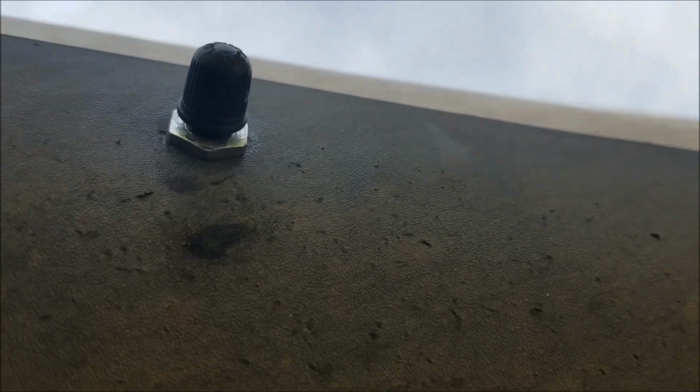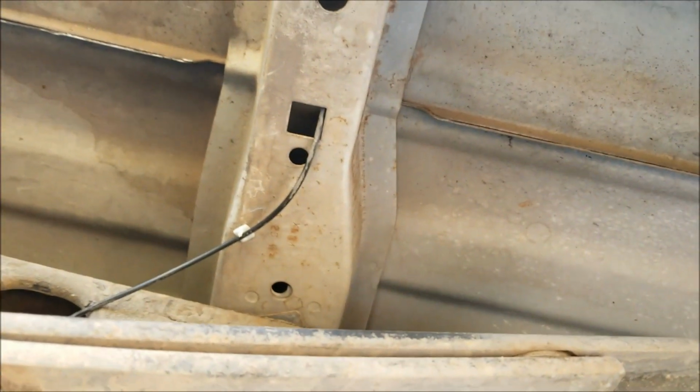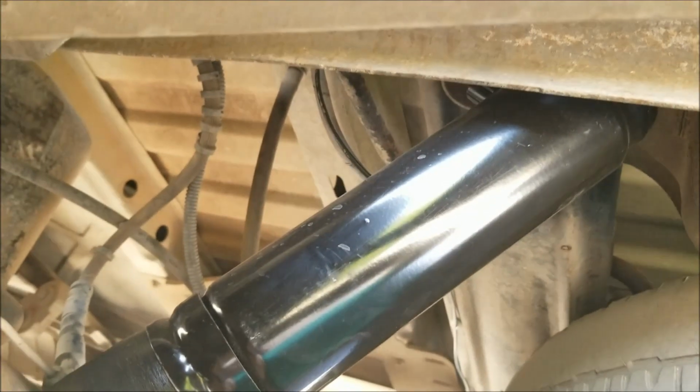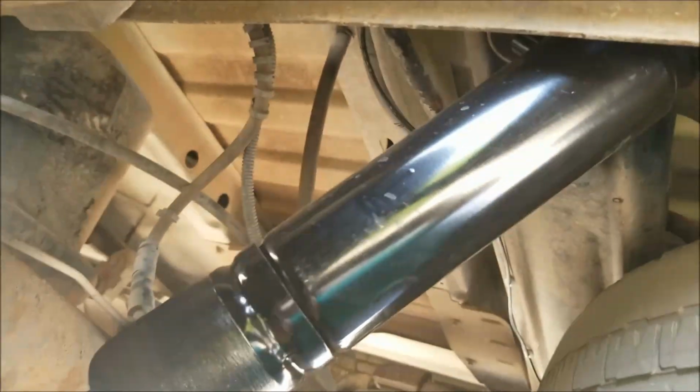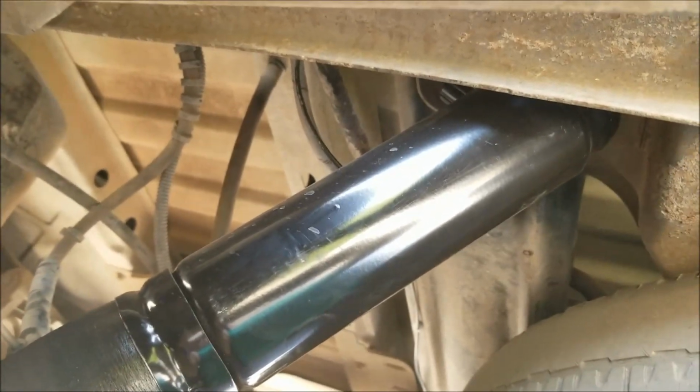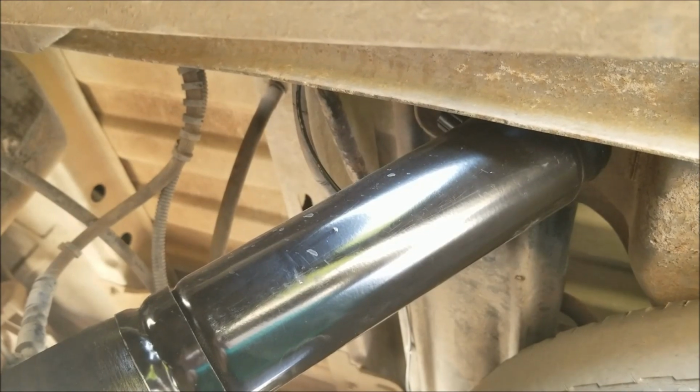So that's the installation. They say after you pressure it up, I've got about 40 pounds in mine and it raises it a couple of inches right now. They say after you pressure it up to check all the fittings, especially the T and where it goes into the shock, spray some soapy water on it and see if it's leaking. I did do that. I found one that was leaking. Actually, I could hear it as well. And once I sealed that off, it has held.